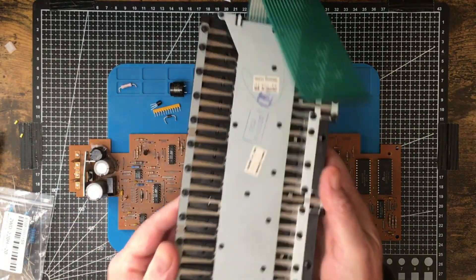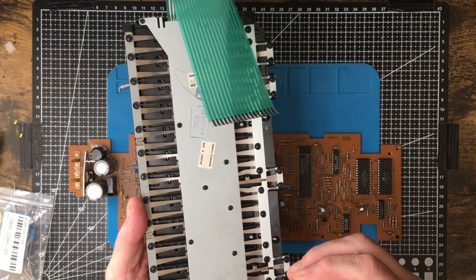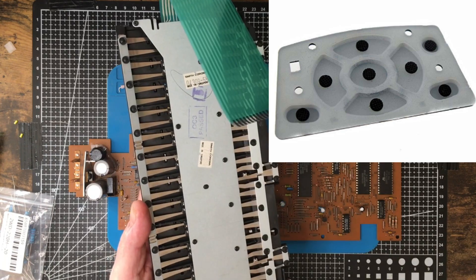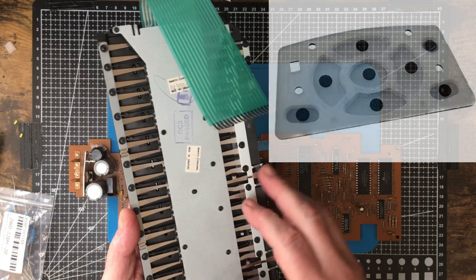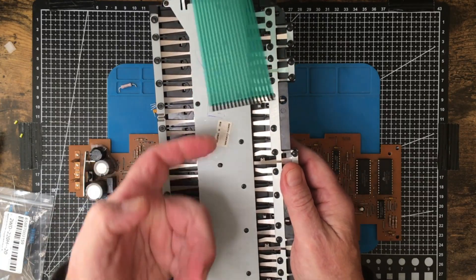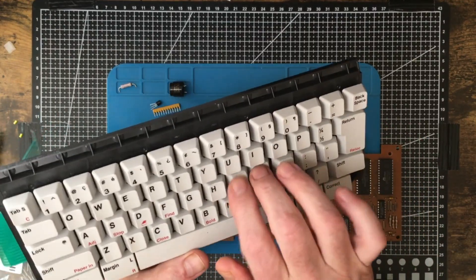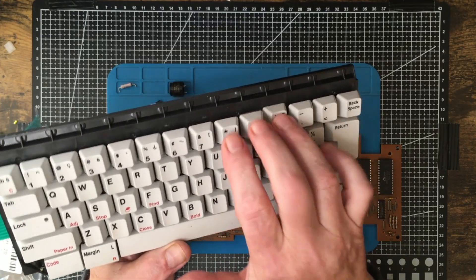It's a very strange device. It's got these leaf springs, and underneath this bar here it's just like one of those rubber keyboards, where you've got a printed circuit board with a pattern on it. You've got this little rubber molding with all the key switches and little conductive contacts underneath — just like you'd see in a multimeter. They attach all the keys with these strange leaf springs that operate the switches. Normally those kinds of switches feel like crap, but Smith-Corona came up with a way to make them feel pretty good — actually quite excellent.